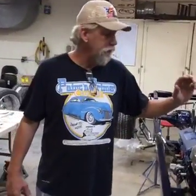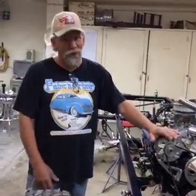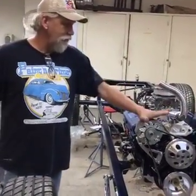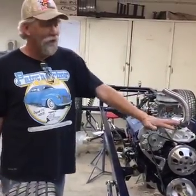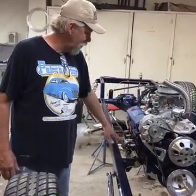And maybe a melted car. And maybe a melted fiberglass. Once you get it started, it doesn't start burning easy, but once it starts burning, it burns very thorough, and you'll have just a white shell of fiberglass, but that resin will be gone. So I'm going to say never, that's my opinion, but never run your alternator wire in through the car. It's not necessary. Run it right to the starter.